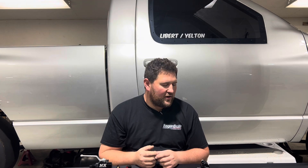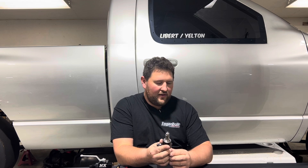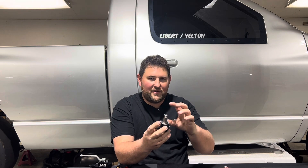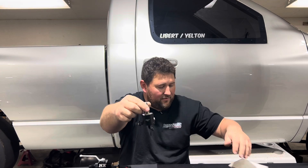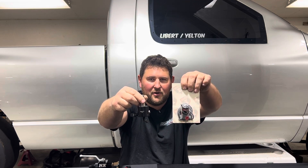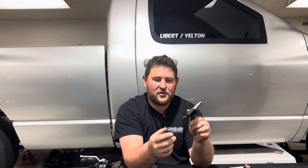Anything larger than just spooling, or if you're new to nitrous and going to stick like a 50 or 60 jet in it just to see what nitrous feels like, these small solenoids are perfectly fine for that. But anything more — where you're using nitrous for down-track performance — you're going to want to step up to a bigger solenoid. This is a Nitrous Outlet pro mod solenoid, and you can see it is quite a bit larger than the smaller purge solenoid. This one here is actually a .136 if I remember correctly, so this will flow as much as a .136 or smaller jet.